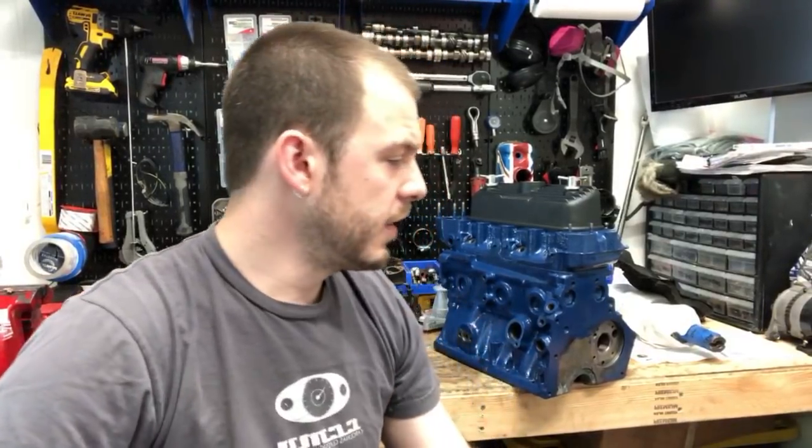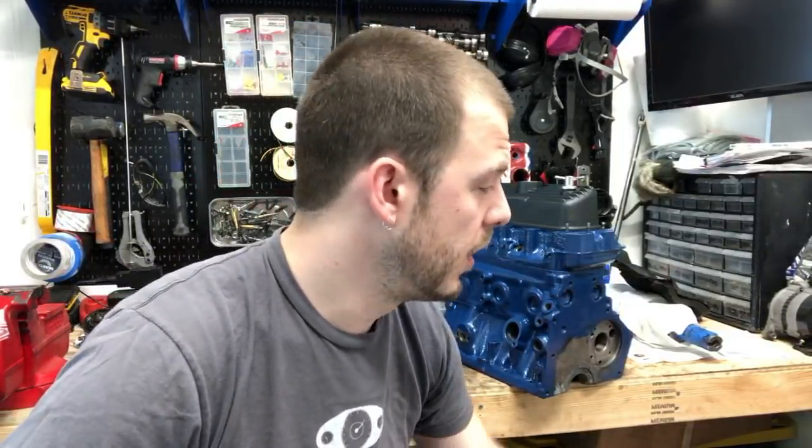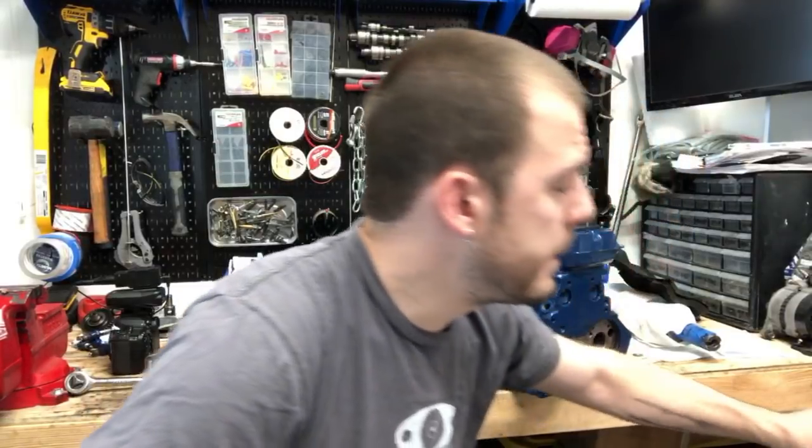Make sure I didn't miss any questions. Shoes Gregory says, can I do something wrong by adjusting carb? Too much fuel or air, too less of it? So yeah, adjusting the carburetors is always going to adjust that fuel. If you have too much, the car's just going to run really rich. It's not really going to run that great. If you have too little, it'll be too lean, and then you can cause overheating issues, things of that nature.